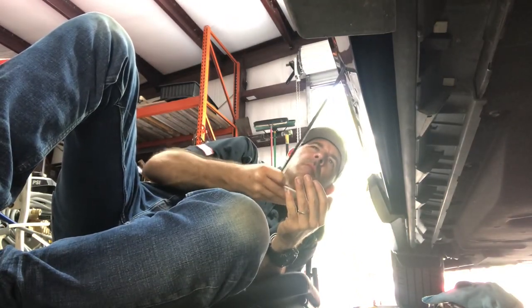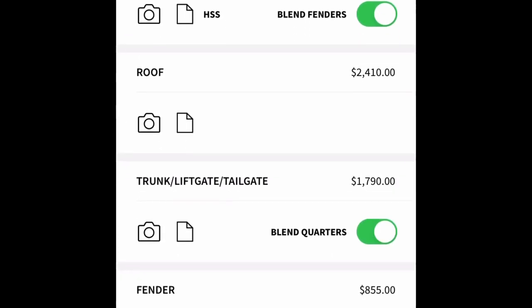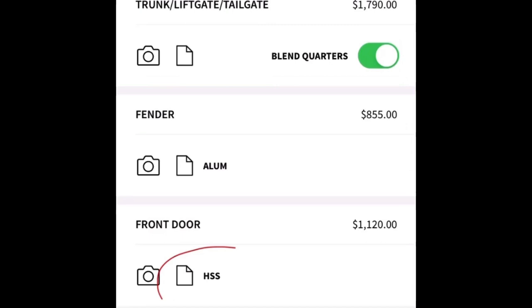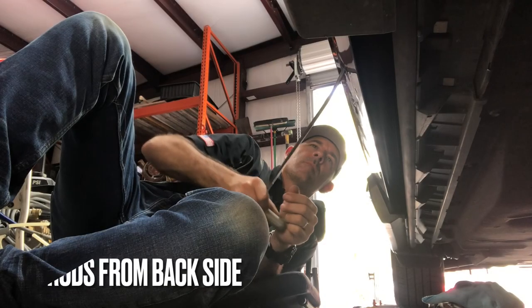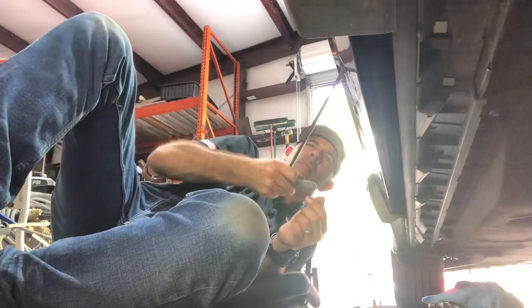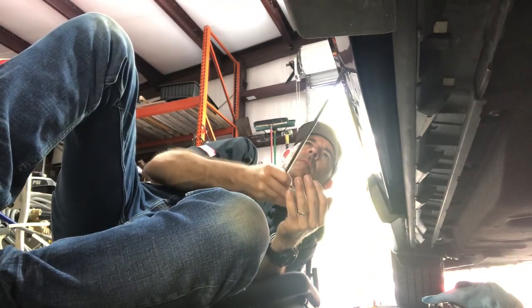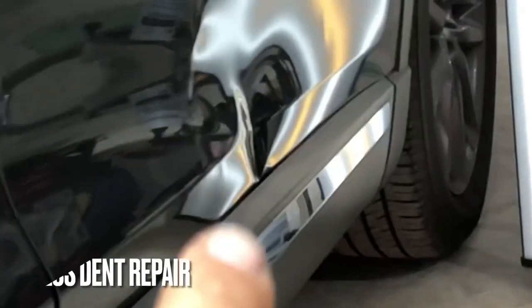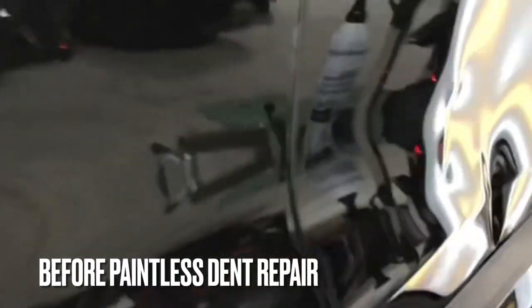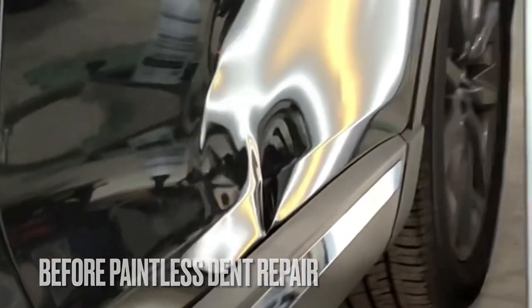And I mentioned one of the factors being that the dent was on the body line — well, high strength steel is actually another factor we use to determine the final cost. What you're seeing here is me putting a rod to the backside of the dent, manipulating it from the backside incrementally. You can see I'm using one of the factory openings there. I chose not to take this door off — sometimes we do take doors off just as a comfort thing, but this particular one I felt didn't need to come off, and I was able to do it successfully.